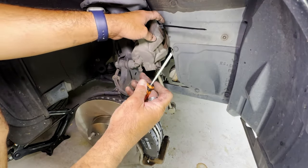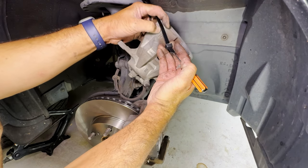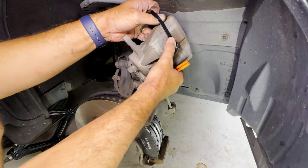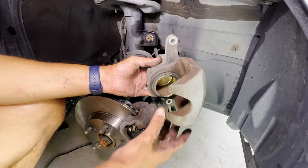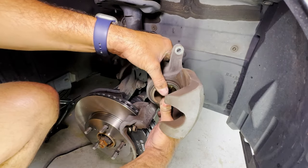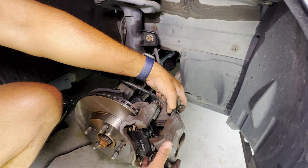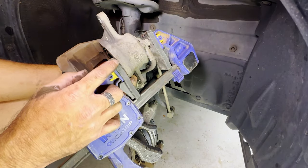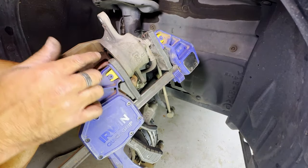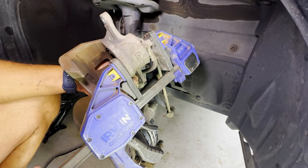Time to put the caliper on. To reuse the cable tie, grab the flathead screwdriver and lift up the clip. Be very careful not to drop the caliper. Now if you can't get it on because the piston is out, you'll need a C-clamp to compress it — it is super tough, you won't be able to do it by hand. I've used a quick-grip clamp because it has rubberized ends so as not to damage the piston. Squeeze it until the piston is flush, then it's time to pop it on.